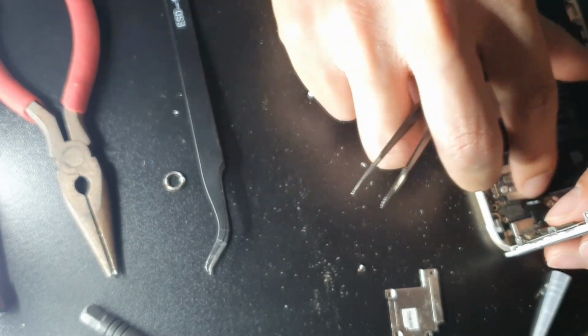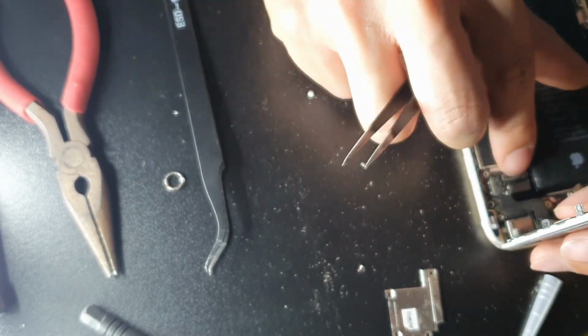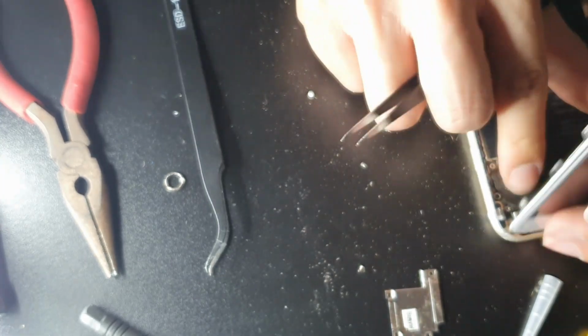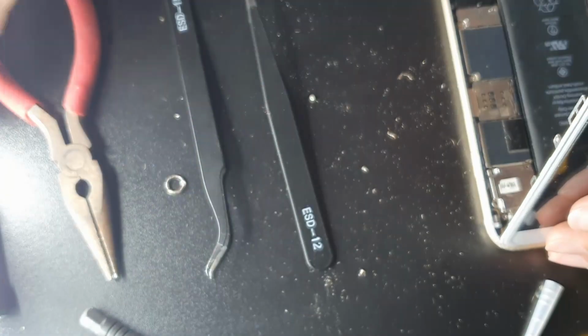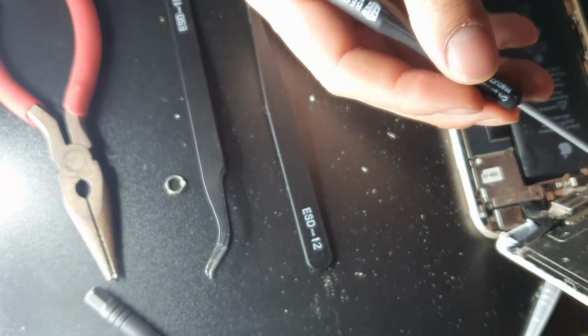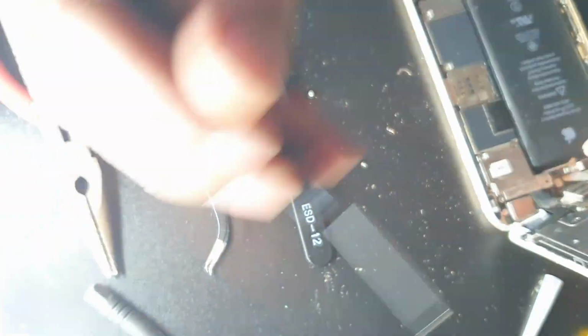The front screen, but you'll see here in a second as well, the front screen is pretty easy to take out. It's a couple of clips. You do need a suction cup, two screws, and putting back the security clamp that's on there as well, as you guys can see now. Besides that, that's pretty easy to do.